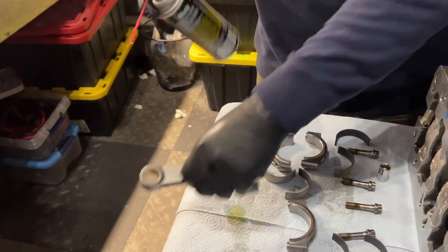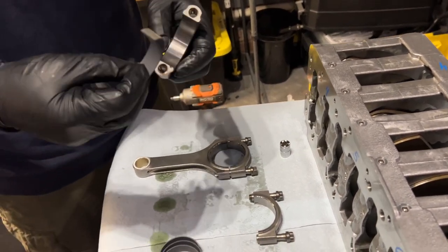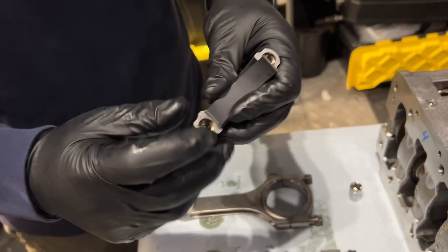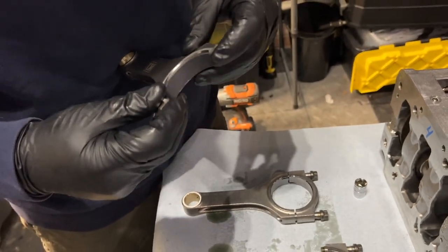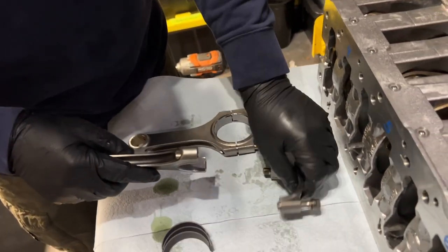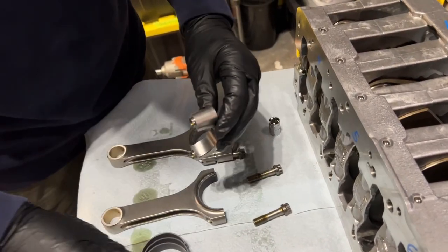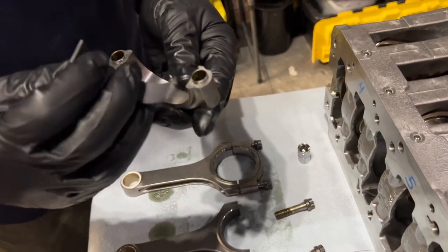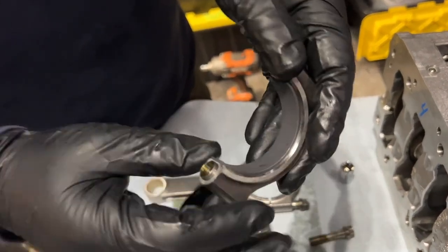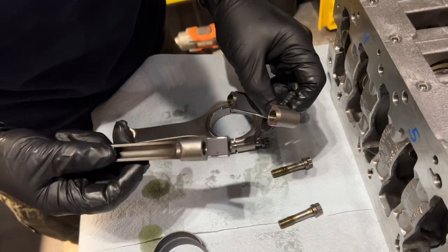And then we'll do the installation. I've got a stretch gauge. Never used it before. We'll figure that out. They recommend using a stretch gauge for these bolts, even though they also give you the alternative torque and angle method of doing it. So there's a number. Put the tang. Right, and remember, assemble them dry, as they're supposed to be.